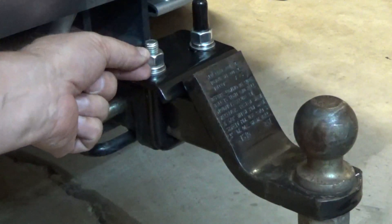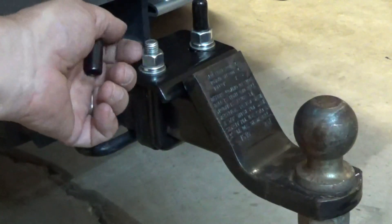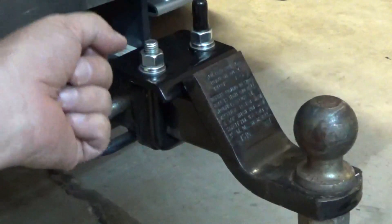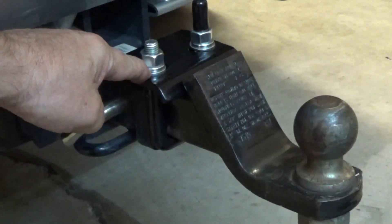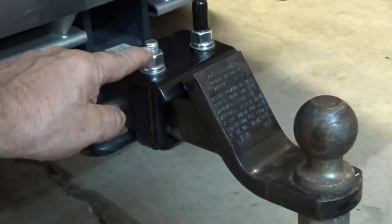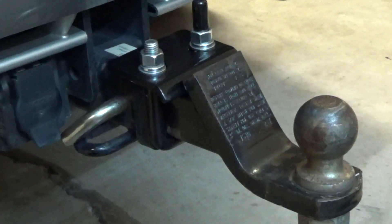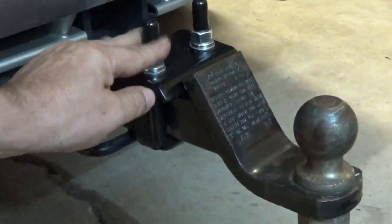Those few threads — unless I get a different bolt, like a flange bolt where it looks like a nut and washer all combined together with serrations to help lock it down — I could eliminate the lock washer and just bolt this to the flat washer. The whole point is if I can get a few more threads exposed, I might drill and stick a pin through there as a safety. It's also a good idea to put a cap on it — I might cut them down and make them smaller.